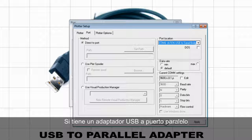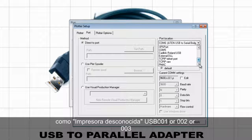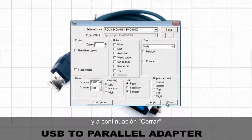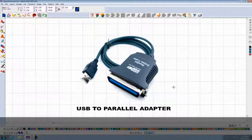If you have a USB to parallel port adapter, it will normally appear at the end of the list as a known printer — USB 001, 002, 003 with a plus at the end. It might also say Printer USB 001, 002, 003 plus. Try those ports, click on Apply, click on OK, and then Close, and you are ready to cut.